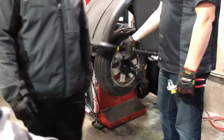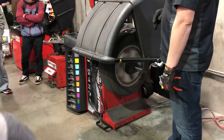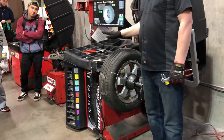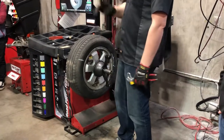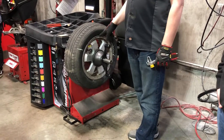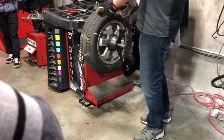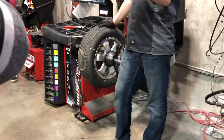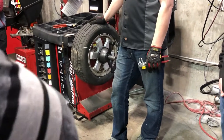Now I want to prove that it worked, because you might put a weight on and find it's still out of balance — maybe there was a bad calculation when you spun it, or it wasn't seated tightly. So I give it a verification spin, looking for two okays. There we go — the tire is perfectly balanced, remounted, and the air is back up. The only thing I didn't do was line it up for road force. But this is on the Prius — deserved well-balanced tires driving that thing around.